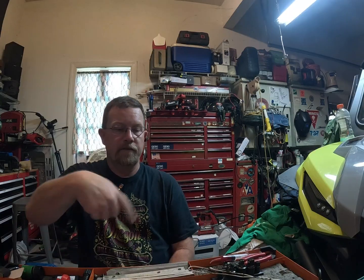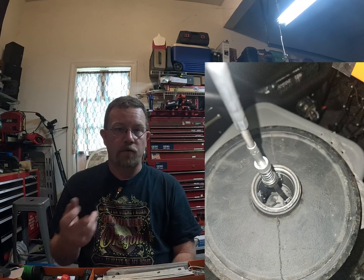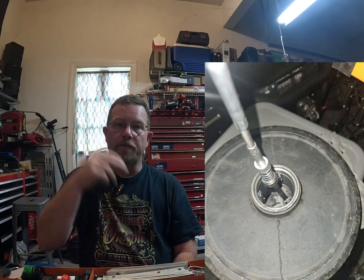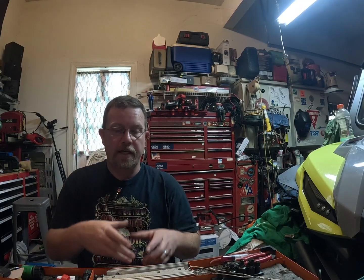Now you've got just your idler — clean it out. One thing I recommend: look inside for scratches and scrapes or anything that doesn't look right. I'll have the tool I use in the description. Go back and forth, smooth that out, get it deburred. Clean it up really good, go back through and clean it again. I use acetone or basically brake cleaner. Once you're done there and you've got that area all cleaned up, just make sure you don't have anything scratched up.